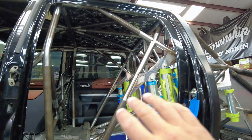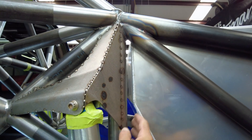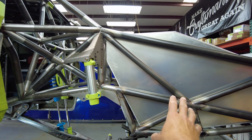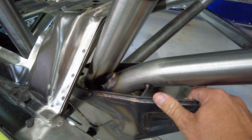I'm going to go under here and show you how we tied into the frame pivots. This cradle comes with this vertical tube here, which is really nice because you just square it up to the truck however you need to and then you connect the dots. Part of the integration was to start the pivots at the end of the frame — and that lended to starting the rear chassis right at the pivot. So you'll see there's no frame rail going to the back of the cab; it's all chassis tubes from here on out.